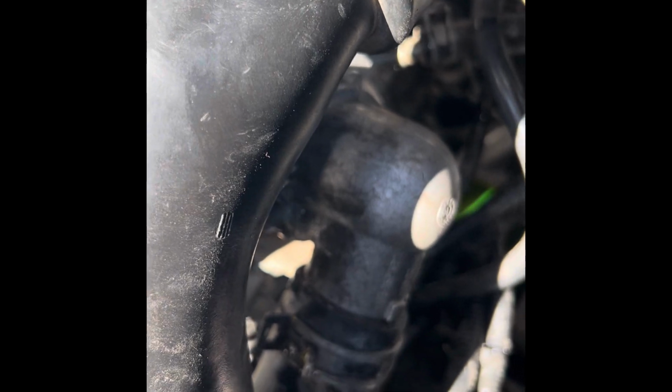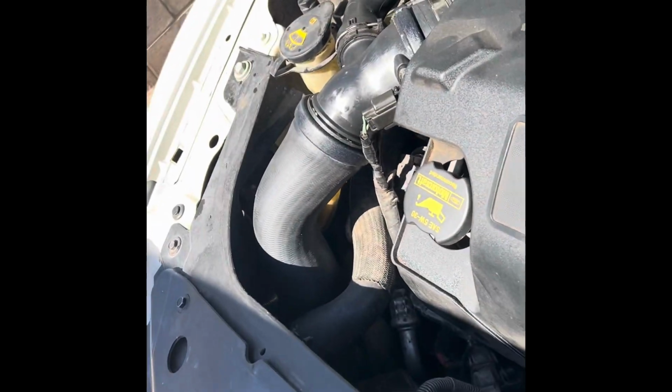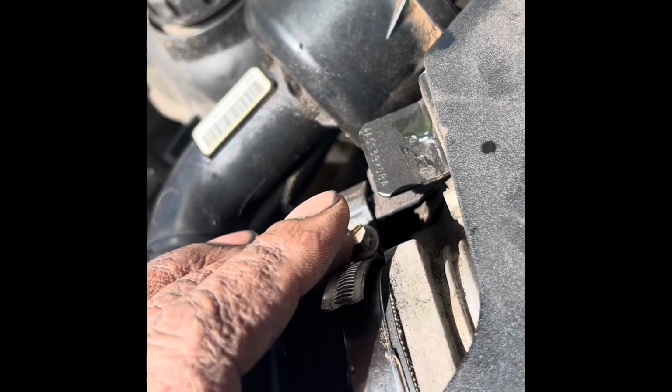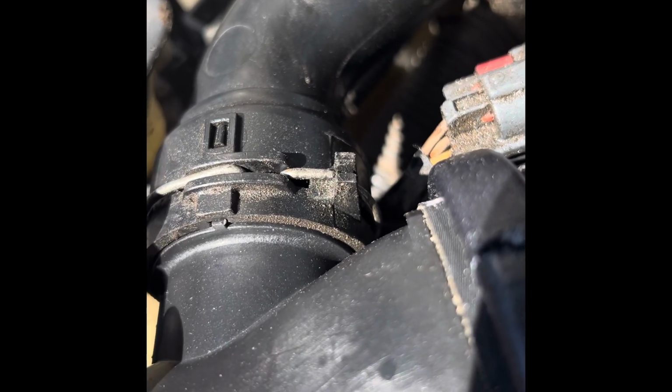As you can see, the repairs have been completed. New thermostat has been put in. Replace this 8mm bolt, one below it diagonally. Also for this intercooler piping, all you gotta do is undo this 8mm clamp, take up this clip right here. You use like a pick or something like that, and you just pull it upwards. And then there's a clamp right down here at the base of this tube, excuse me, right down here. Let me see if I can get you.